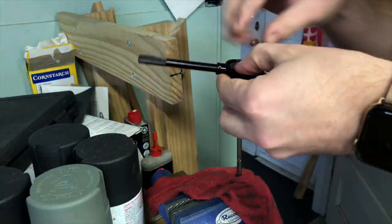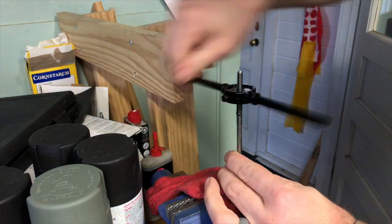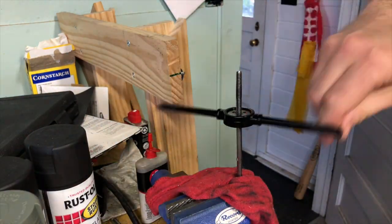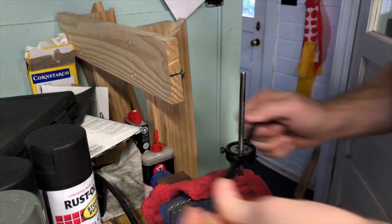The brake connecting rod is designed so that the spring rests against a washer that butts up against some pinched nubs on the brake rod. I'm going to extend the threads and add a proper nut and a stop on there.